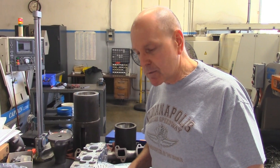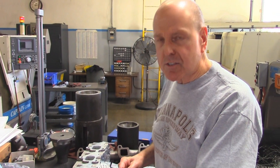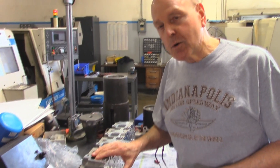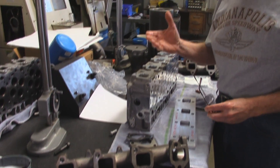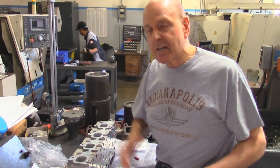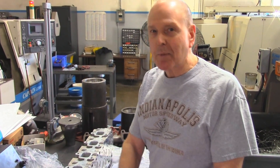Our streamliner has been 382. These manifolds — we've designed them to do the streamliner thing — in other words, sustained wide-open throttle — and to always have perfect port match regardless of the temperature of the manifold. Everybody brags about how their heads flow, but if you put on a mismatched manifold, you ultimately kill the flow of the port. We're all about not diminishing the head with our manifold.